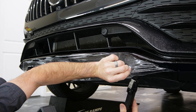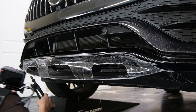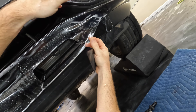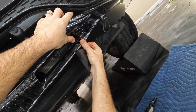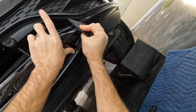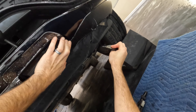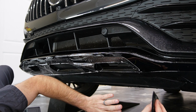Let's get some slip solution in here and get it pulled back up right to that line. We'll start with slip and then work our way to using some tack solution. This area here has some tension, so we're going to pull back on that just a little bit — let's see what that looks like right about there — and then squeegee this out. I'm holding this down with my thumb right there, and I could even come further back, allowing me to squeegee that out and have it stay down.